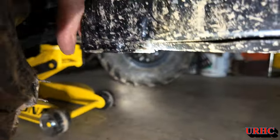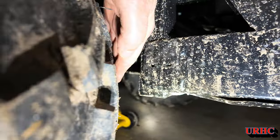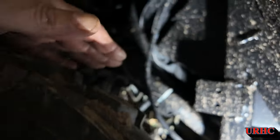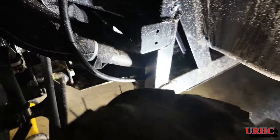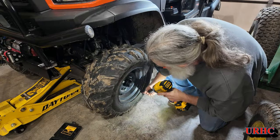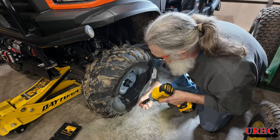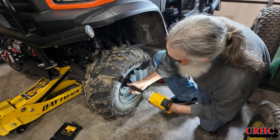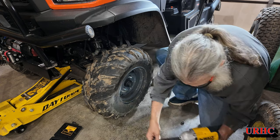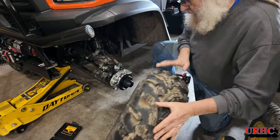Here's the problem: these are the stock tires and there's only about an inch of clearance with the stock tires when you turn the wheel to full lock. My other ATV tires from Gizmo are about a little bit over an inch bigger in diameter and an inch wider, so it would have been too close. The offset on these wheels wasn't good either — the wheelbase center to center was about three and a half to four inches narrower. I wanted to fix that so it would fit my trailer E-Trax, so I went to Orange Aftermarket to find wheels approved by Kubota.